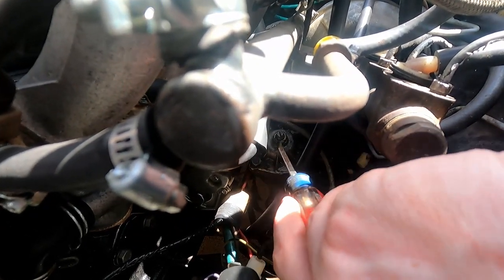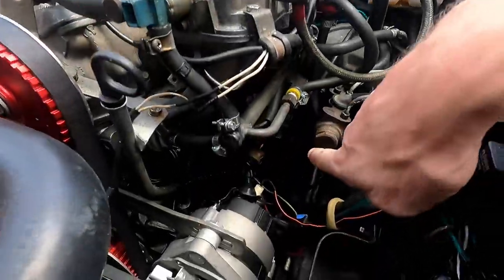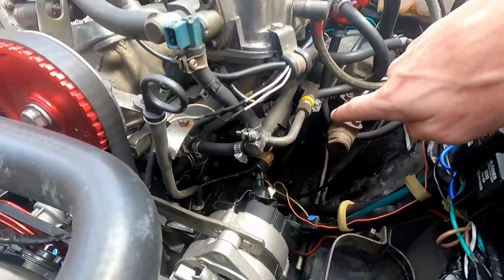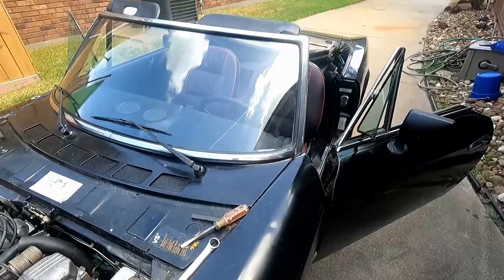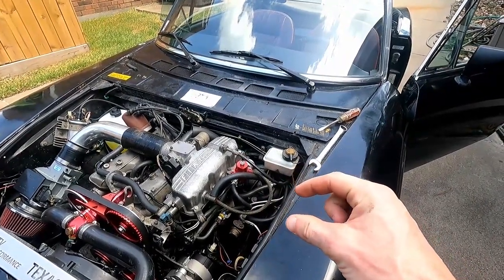So we're going to break that loose and start tightening it up. We've got it all tightened up — that screw is down in there now. I ended up doing about one and three quarters turns because there was that much slop in the steering wheel. You might have to slowly back out that nut a little bit and screw it in some more.